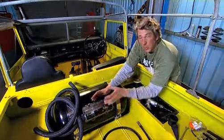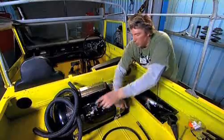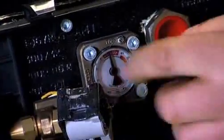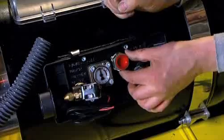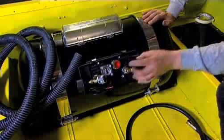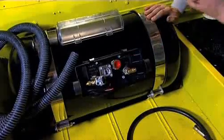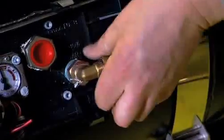On the tank is this very important air-tight box. Inside you've got the solenoid valve, and that gives your gas to the engine. Next to that is a gauge, so you can see how much gas you've got in the tank. Next to that is a very important pressure relief valve — should you get caught in an accident or a fire, rather than the tank exploding, it vents the excess pressure through this valve. The bit I'm interested in right now is the inlet.